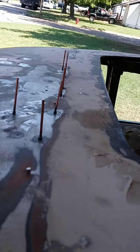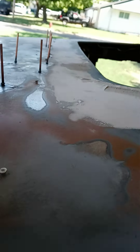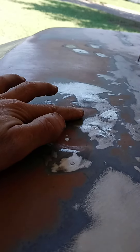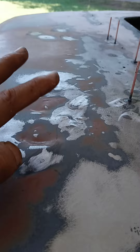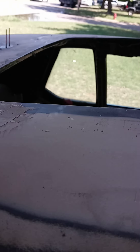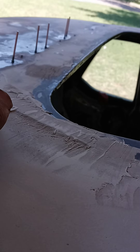I went along this side and that's what I got — it's just gonna take some slight body filler. Now I gotta worry about fixing these dolly hammer marks right here, so that's my next step. Then sanding down on the sunroof — pretty much ready to shoot the primer and feel out what little imperfections I have.